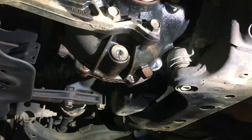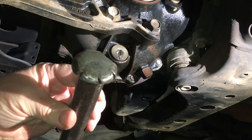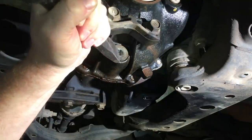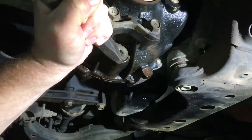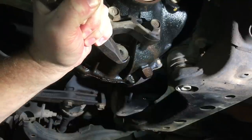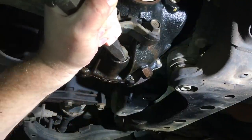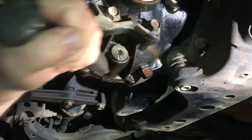The sharp chisel was just to put the mark - if I try and turn it with that, it's going to chisel and cut it away. So we put that down and get the big chisel. You can see it's been used - look at the end, it's quite flat. I want to sit it in there, lock it in, and give a few gentle taps to get it in a nice position.